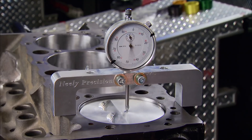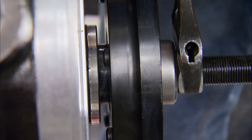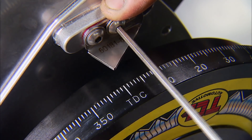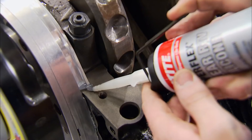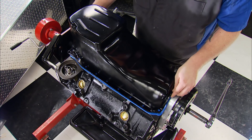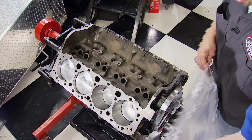Don't forget the belt retainer. I'm verifying top dead center to install our balancer — it's a TCI Rattler with an external balance and a floating weight inside. It's noisy but will give us extra assurance on bearing life and absorb harmonics at higher RPM levels. After a thorough cleaning, we're going to reuse our Melling high-volume oil pump. The rear main gets a new seal, the block gets some silicone, and a one-piece reusable oil pan gasket from Fel-Pro. The old pan and pickup are a pair — with a little black paint they're reunited, and our short block is done.